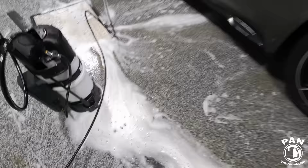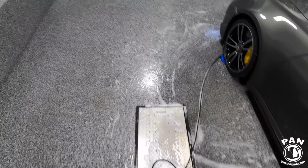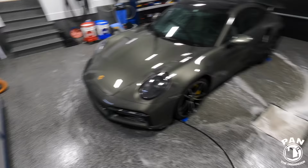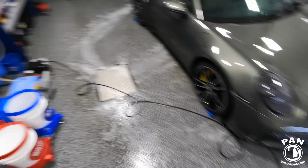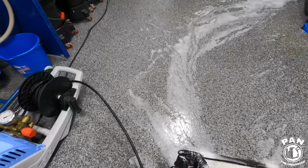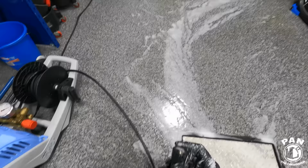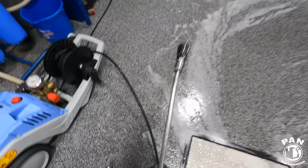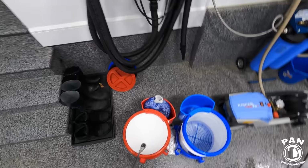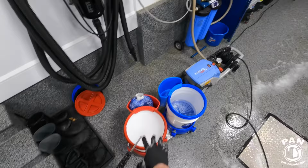All right, at this point, it's up to you to either foam the vehicle again before the hand wash, but I know my procedures, and with everything that I did with the snow foam and the pre-treat, the majority of that loose dirt and debris is off, so I don't need to foam again. I'm just gonna go directly to the bucket wash, and in the bucket, I used CarPro Reset, my favorite shampoo for cleaning vehicles. So it's already in there. 1.35 ounces in your wash bucket as recommended on the label.